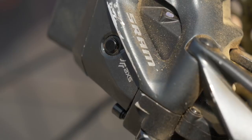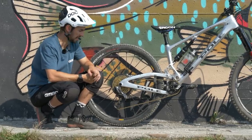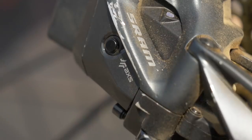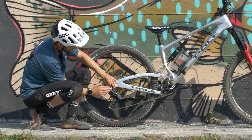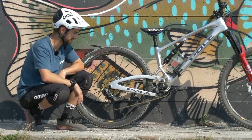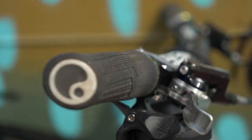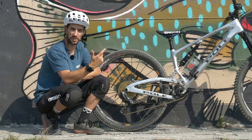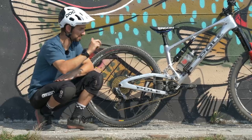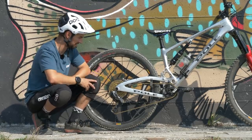The bike came with the SRAM Eagle drivetrain. You may have seen in the Superbike video where I did some upgrades — I've now got the SRAM AXS wireless gears. It's 1-by-12, with the controller up on the bar and the rear mech; you can see the battery there — it just unclips. Interestingly, it was my first time flying with it, so you have to remember to take the battery off and put it in your hand luggage. On the app you can switch which way around it shifts — I've tried a couple of ways and gone back to the default: the paddle nearest the bar shifts to higher gears, the furthest away goes to lower gears, and that works really nicely.